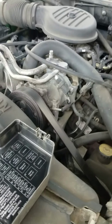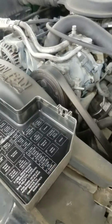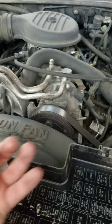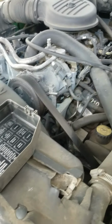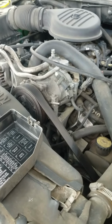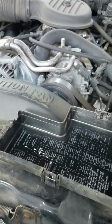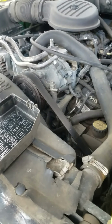The other thing is that when you're repairing or replacing components like the compressor or the condenser or the accumulator or the evaporator, you have to add oil to it. You can't just put it in there and call it good. They call it balancing the oil. So when you take your old compressor out, you drain it into a cup. You take your new compressor, they always come with oil, drain it into a cup, and kind of decipher what the difference in oil is, and then add oil in proportion to how much came out. So if you drain it and maybe an ounce comes out, add an ounce, and then add maybe another ounce or two, just because you know that some of it's leaked out. It's always better to have a little bit more than not enough, because you'll end up burning it up. But on the flip side, if you have too much, it kind of makes the AC performance suck anyway.